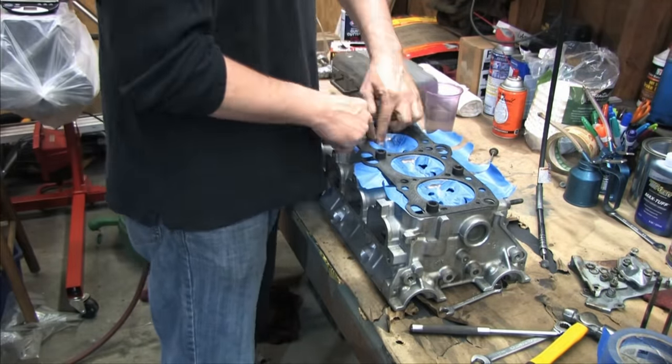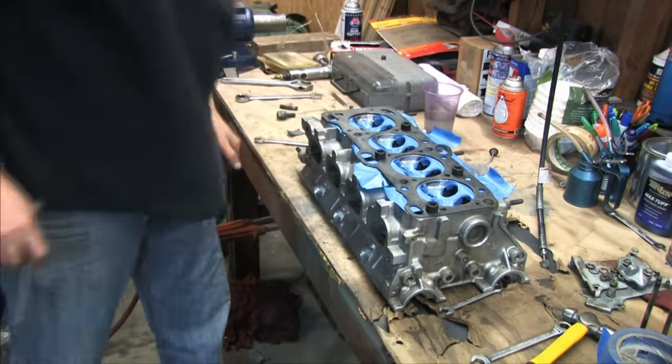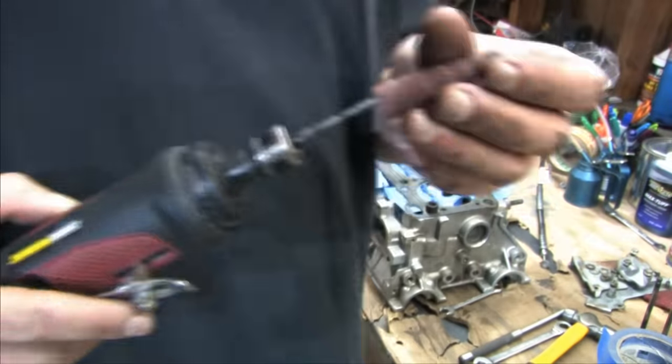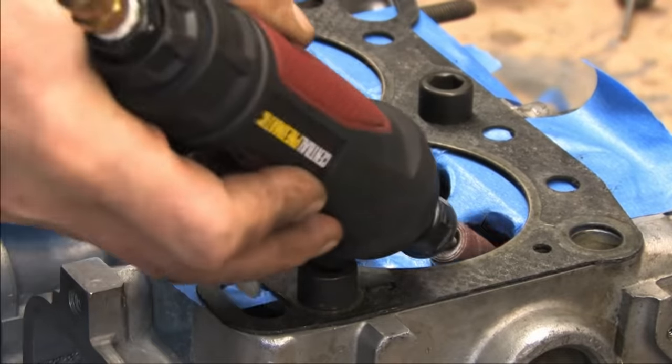You know, in baseball, when you're chasing a pop fly through the outfield looking up, there's a dirt warning track several meters around the outfield fence so that you can feel it with your feet prior to plowing into it. The top half of the valve seat is off limits, and the tape is there to alert me that I'm about to run into the proverbial fence. It lets me judge how close I'm cutting my work in.